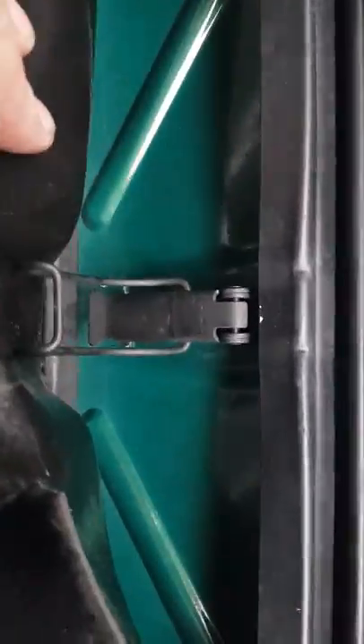Inside the car you'll have a zip with a little tag on to stop the zip unzipping. Remove the little silver tag and unzip the top half of the window — it unzips all the way across. Go inside the back of the car, pull the trim away, and you'll have five little catches that you release. This will then lift the back of the roof up.